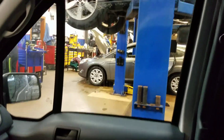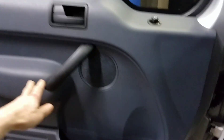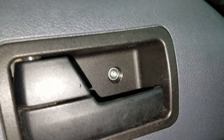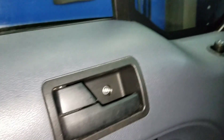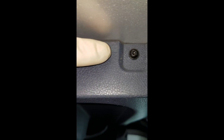The other side you can see going up and down, so we're going to go ahead and start by pulling the door panel off, which basically just unclips. We went ahead and popped this little button out of the door handle area — you can see the bolt there — and we're going to remove that.